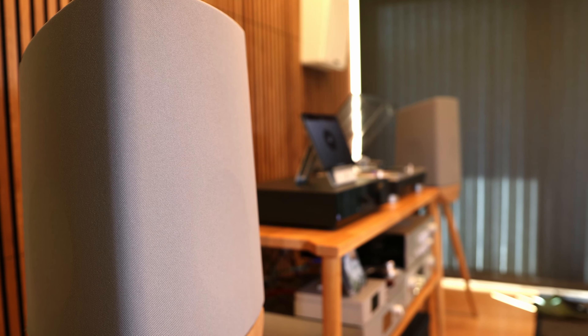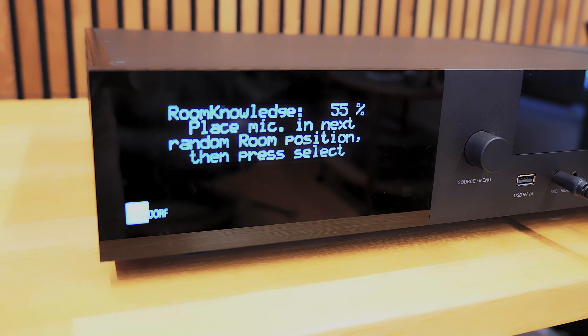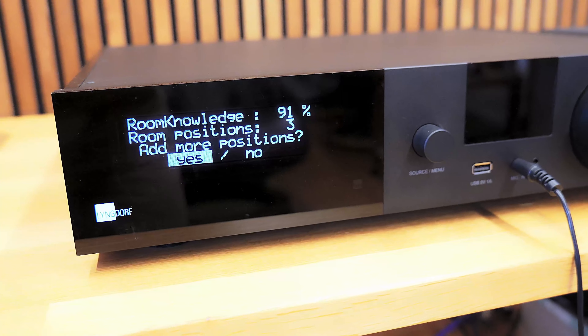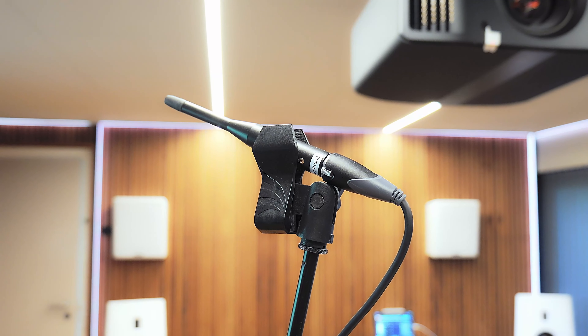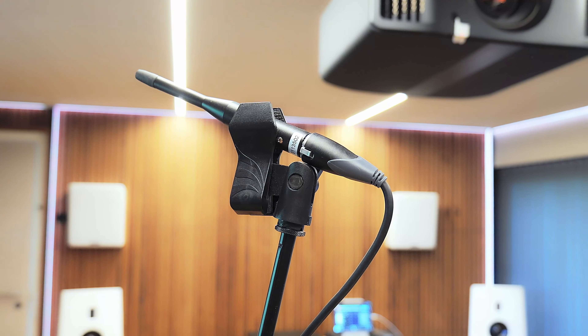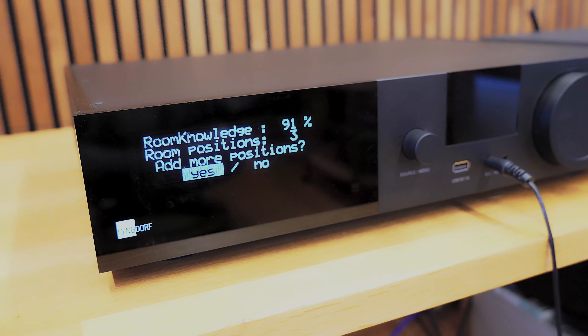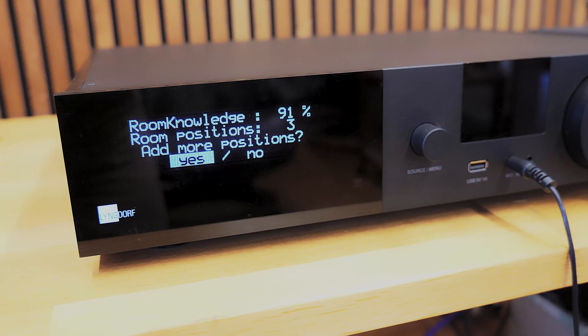There are presets provided and a diagram showing you where to connect the speakers and the woofers. You will want to take advantage of the built-in RoomPerfect room correction system in the 3400. It's a great and musical system overall that also ensures perfect woofer integration and can compensate for less than optimal speaker placements. To do the room measurements, you simply follow the guide and move the supplied microphone. After running RoomPerfect with two BWV2 woofers added to the mix, a brand new beast of a setup is revealed.